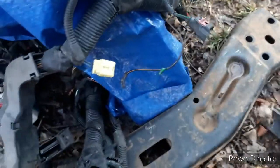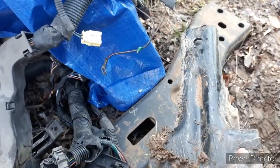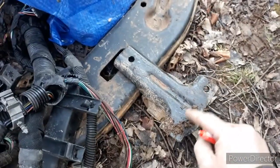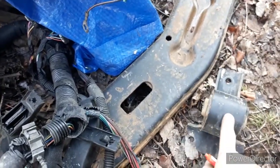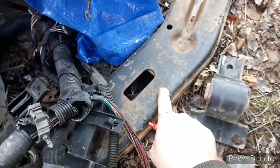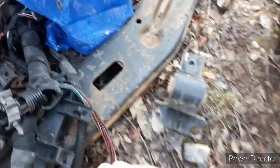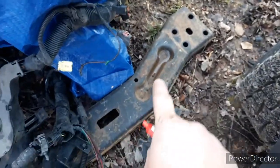That is this piece here. The 2004 is what's in my hand. This is where it bolts to the transmission - it's got four bolts on the 2002. This is the same width, so this is the 2002 cross member. You don't need it - you want the 2004. The 2004 has different bolts and it doesn't have this bend in it.